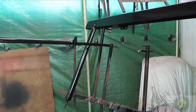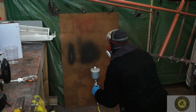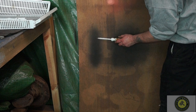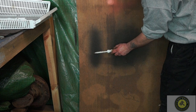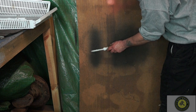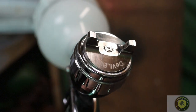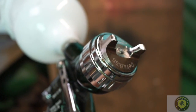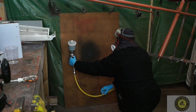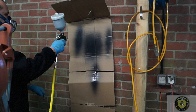The day didn't go as planned because I found that the air cap gave me a non-oval spray pattern — it was actually more predominantly painting at the bottom end. You can get this with a blocked air cap or by pointing the gun in the wrong direction. The air cap has two horns, and if one of the air holes is partially blocked you will get a misshapen spray pattern. This is what happened — I had to clean the gun rather quickly and then carry on. But hey ho, that's life.